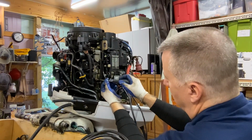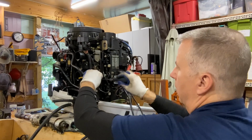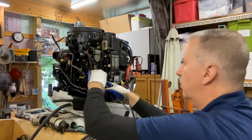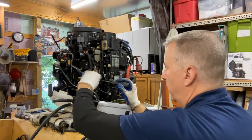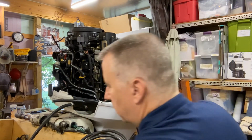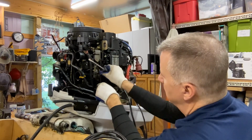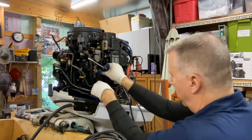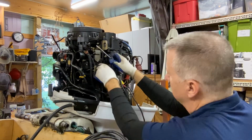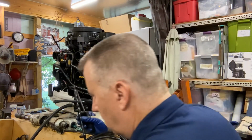As you can see, when the screw comes out, there is a little plate here, like a fork, that is fitting onto this fuel rail, holding it in place so it slides off, right? So that fork, I'll show you when we get the fuel rail off how that lines up. We just want to wiggle this back and forth a little bit, work it out little by little. We don't want to just yank on it. We don't want to break anything. And it comes right out.